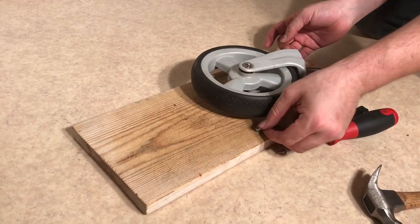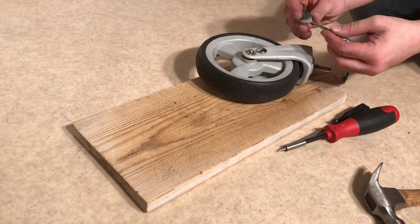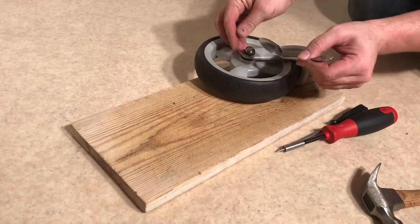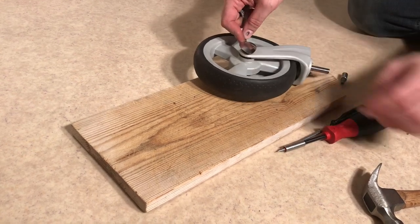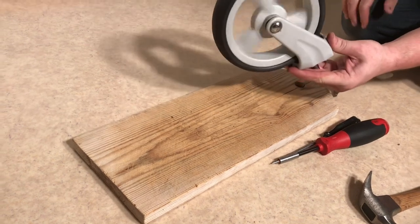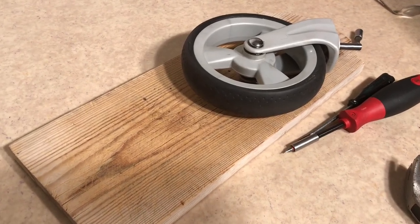When it comes to the cap, if you have a rubber mallet you can use that. But one trick I found is if you take a teaspoon that you don't really care about and you bend it, you can use the natural curve of the spoon in order to preserve the curve of the cap. Just place it over and knock it into place. So that is how you disassemble the front wheel of a Stokke Xplory for the purpose of most likely replacing the ball bearings.